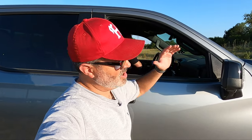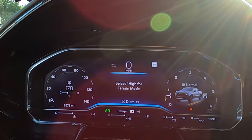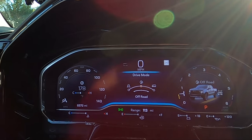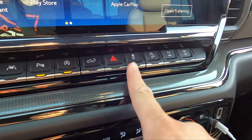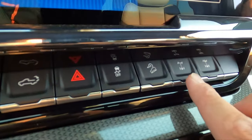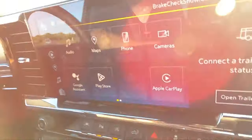Inside, you've got drive modes: normal, off-road, and terrain. Off-road adjusts throttle mapping and transmission shift points. Terrain gives you one-pedal drive for use over obstacles. You also get a full traction-off function — press and hold — which more vehicles should have. There's hill descent control, a selectable rear locker, and uniquely, you can also lock the front differential — something none of its competitors offer.